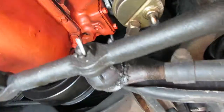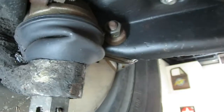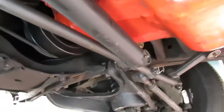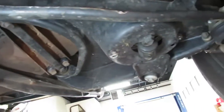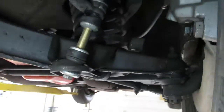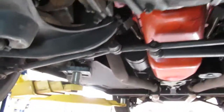Transmission, underside of the engine — all your rubber bushings are greased and they're fresh and not cracked out. Brake line looks good. No damage or scrapes anywhere on your front suspension. So it certainly hasn't been abused at all.